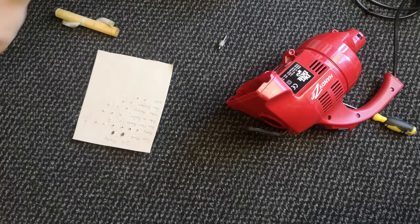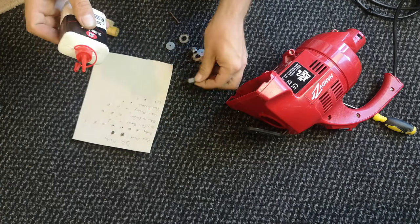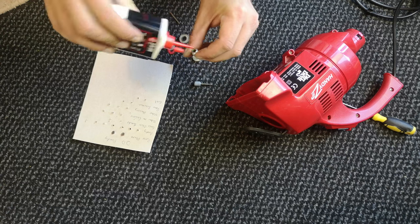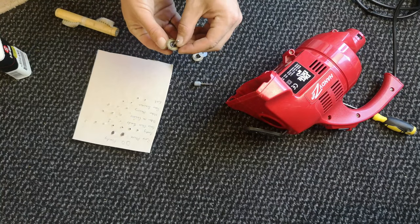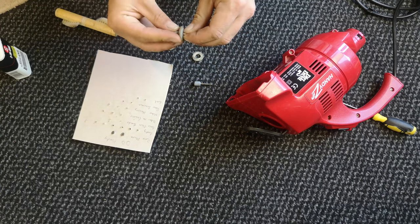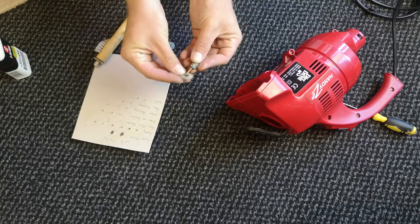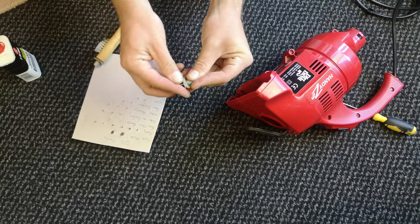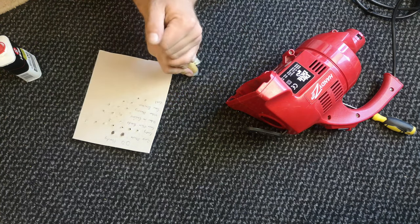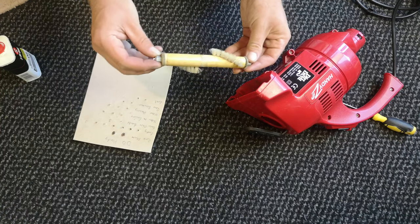With the main machine looking a bit more vacuum cleanery, it's time we look at the brush roll. We'll start with just a mandatory little drip of oil into the brush roll spindles. One is already fitted - I put a little bow on it so I had to put it in with a hammer. This one slides in nicely. They're recessed so they go in that way. That one's pretty scrap isn't it? Then it's this, and then we just have to push them in. This should be smooth and quiet when we're done.